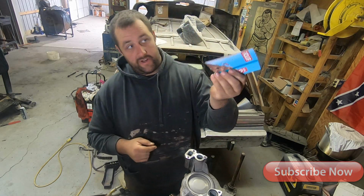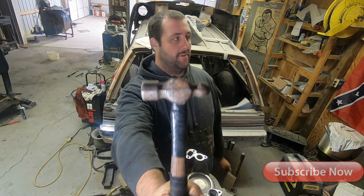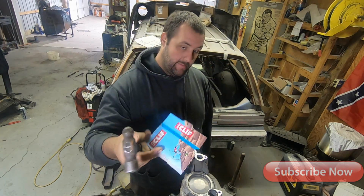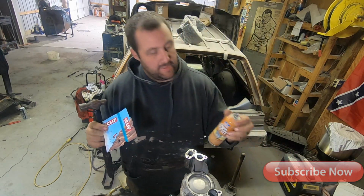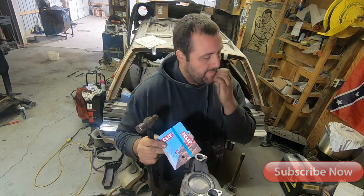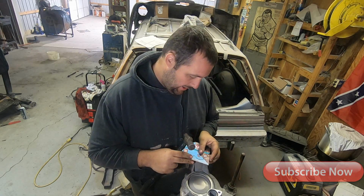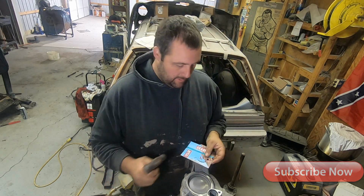So I was going to show you guys how to cut your own gaskets with a hammer, ball peen hammer. This is Old Faithful. This is just some random single ply cardboard. When I cut these, I usually cut them the smooth side up. And if you do make your own, I recommend using some sort of spray gasket material. Obviously, it's not something you're going to do every day, but I have did it at work. Sometimes you just need a gasket. It's the middle of the night. You got to get something together. And I started to do this one, and I'll finish it up.